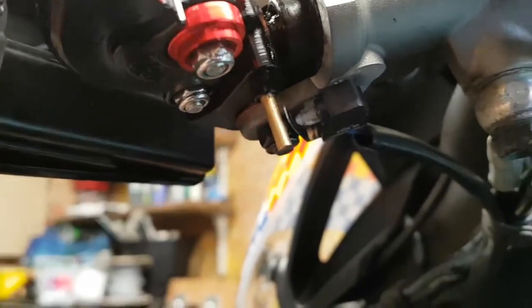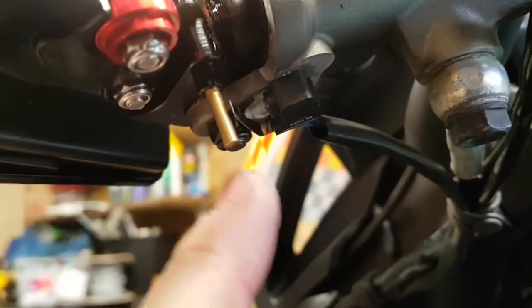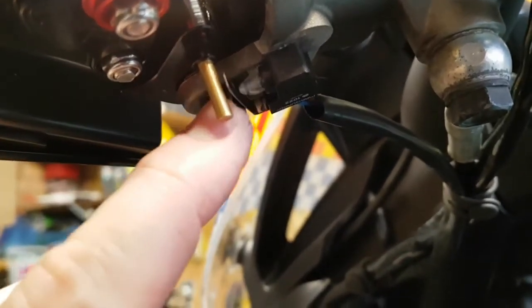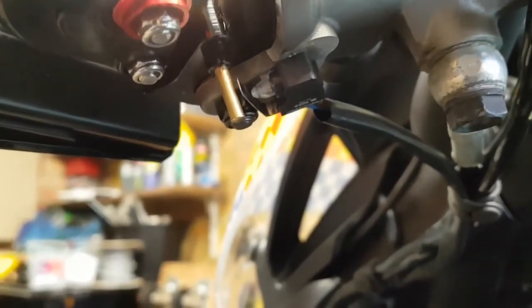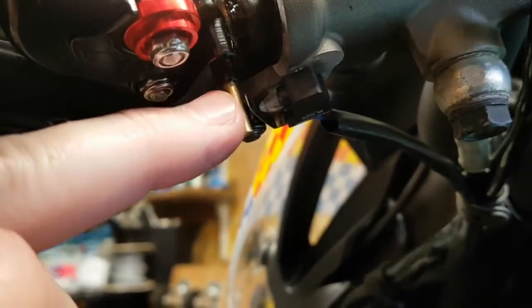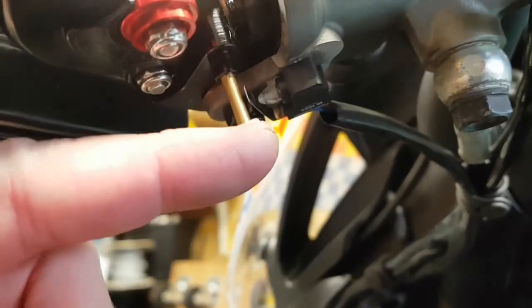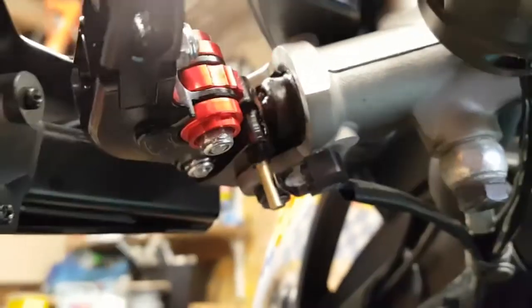The other thing you can also cock up is there's a little brass pin underneath, and you can see the little clutch micro switch lever here. It is possible, if you're not watching what you're doing, to have the micro switch lever on the other side of that pin. Obviously you don't want that. The micro switch has to operate that way, so you can start the bike if it's in gear by pulling the clutch in. On mine, this little brass pin was at a funny angle, which made me look at it, and then I realised it was actually loose, and a very helpful eBay seller said that actually the hole that this brass pin goes into is slightly tapered, so in my case I just pushed it in and gave it a couple of little taps, just to secure it at the bottom of the taper. But do make sure you've got that the correct way.